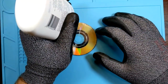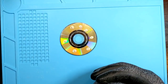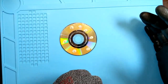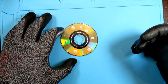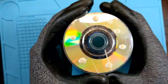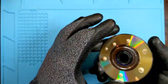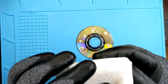GameCube. The nozzle's not clogged. I'll put a couple of dots out — the amount is the first of many steps where it just takes a feeling and practice. You can always remove more surface, but if you cover the disc in Novus and try to take off a lot of material, it'll just make a mess. Start with less than you think you need. You can also put the dots directly onto the scratches themselves for spot cleaning.